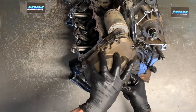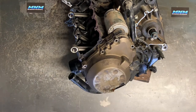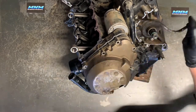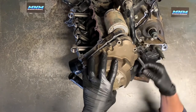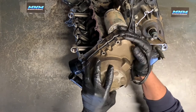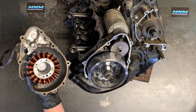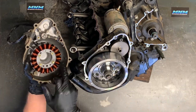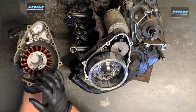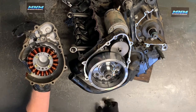This cover should just pop off. You can see we've had some slight damage to this cover — probably not going to be usable. Not sure what happened here; there's some JB Weld on there. We are pulling the stator off now. We have our wire harness that we need to take off as well. There is going to be some magnetic pull, some force, so you want to make sure you've got a good hold on it. This stator appears to be in really good condition even though the cover has seen better days.